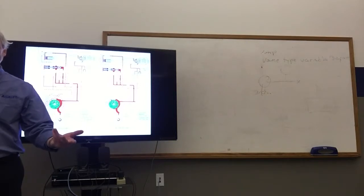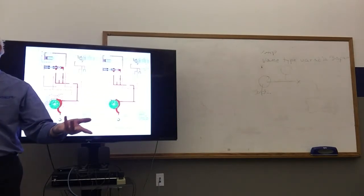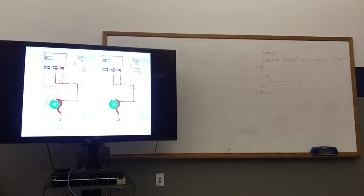Pressure is created by pushing against a bunch of restrictions. The fluid is coming out of our pump as line fluid. Pay attention to how they name these fluid passages, because that helps tell you what they do. It comes out as line fluid and goes to a couple of places. One, it goes to the backside of the pressure regulator valve through orifice number 4, which is located in this spacer plate. How do we find out where that orifice is located? It would be kind of important to find if you had a pressure problem.